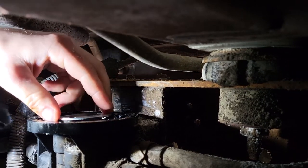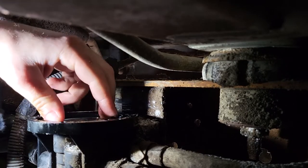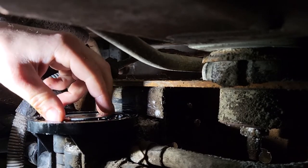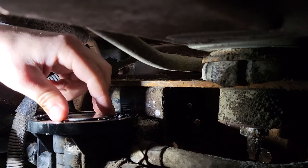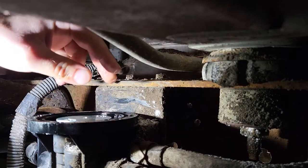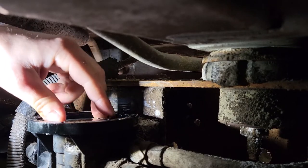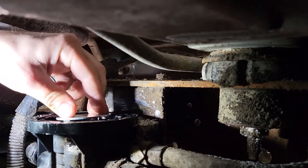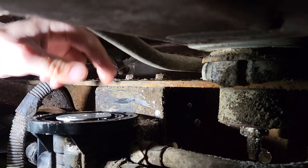The brake system. Yeah. On that. The MGs. Yeah, when your brakes go out on one of the circuits, the brake pressure valve goes off and a light goes on your dashboard saying one of your circuits is down. Not that you probably wouldn't notice, because all of a sudden half your brakes aren't working and you'd probably notice that. But that's unrelated. Totally.